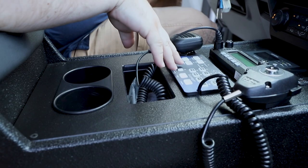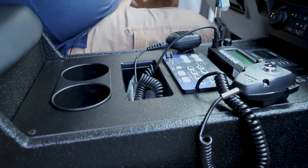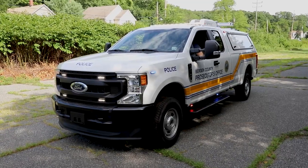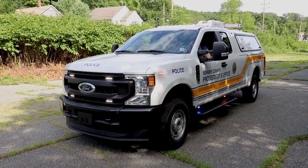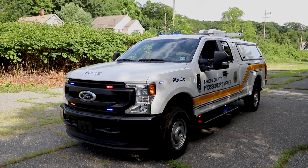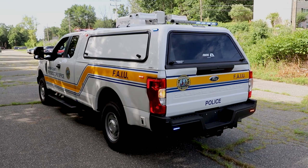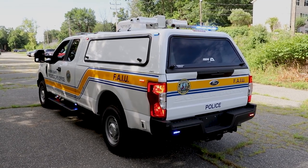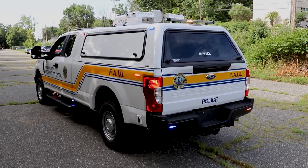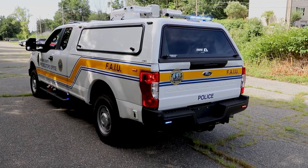Going over the control panel functions: the wail, yelp, and tone buttons do not work while the vehicle is in park — as soon as the vehicle comes out of park those buttons become active. We have our takedown function, left alley function, and a couple of safety features built in. If somebody is following the vehicle, we have the left turn signal shut-off built in, which gives them more scene lighting to the rear. We have the arrow stick override for left, right, center out, then off, and it goes back to flashing.